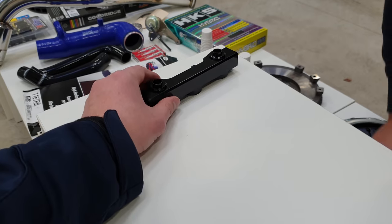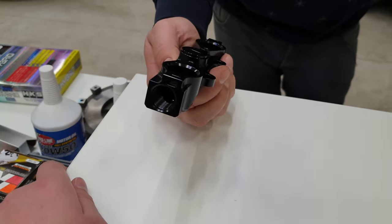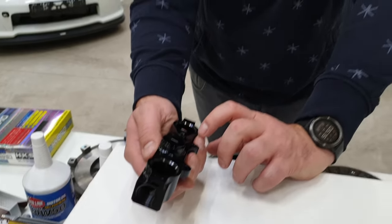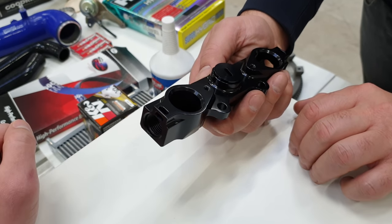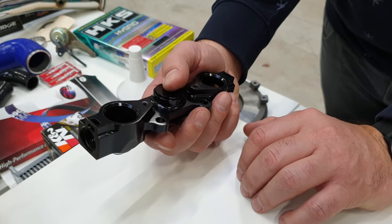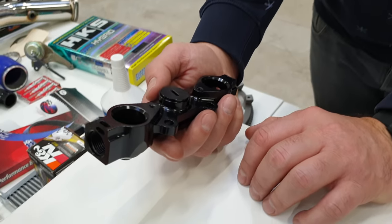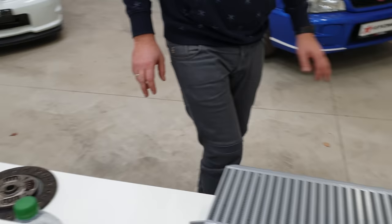This particular part is for side-mounted injectors — for USDM cars. For normal European cars and JDM we also have it here. When you tune or upgrade the turbocharger, of course you must have upgraded injectors, and please avoid the situation where your tuner cuts your injectors to make them a bit bigger, because then no one knows how equal they will be.